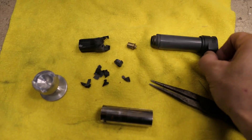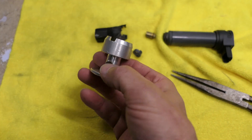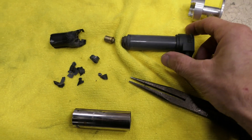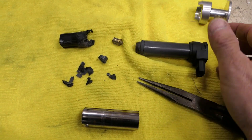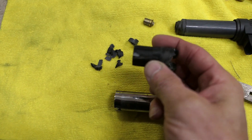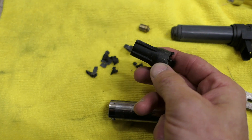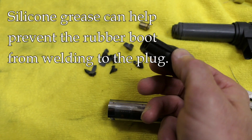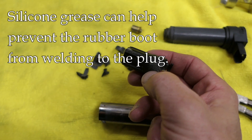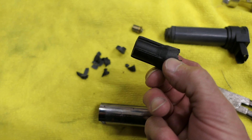This coil is very tight in the opening, and you do need — it's best to have a special tool that looks like this. That slips over the end of the coil and allows you to just carefully wiggle it out, which is what I did. It's also well known that the rubber boot at the end of the coil can weld itself to the metal or to the plug. Because of that, I always install a little bit of clear silicone grease inside and on the outside of the plug, just so that doesn't happen.